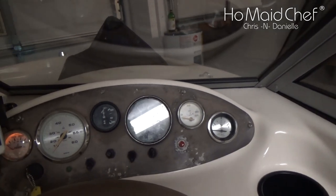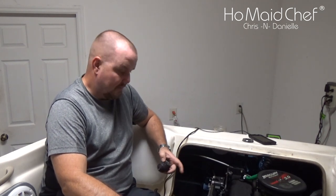The oil pressure is sitting here — it doesn't work, we have no oil pressure. So we got a new oil pressure gauge. It looks much better than this one; this one's really rusted. Hopefully it works though, because we want to send oil pressure up there. We know it's not the line needing to be bled, because it's electronic — it's not a mechanical oil pressure gauge.